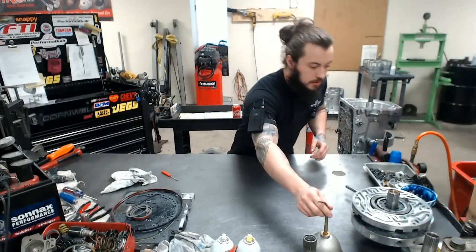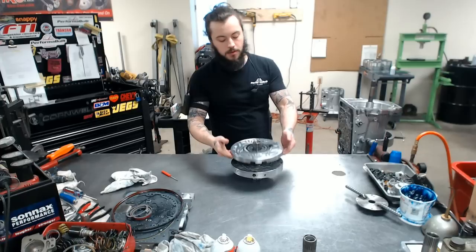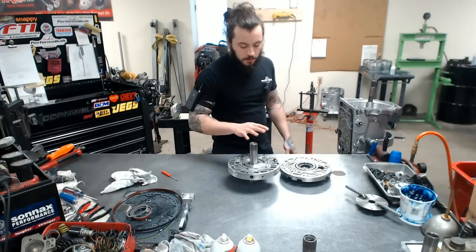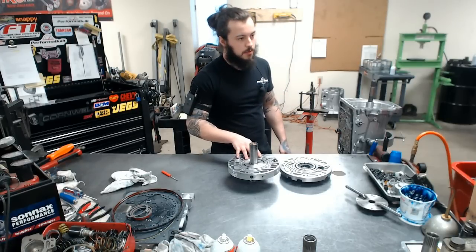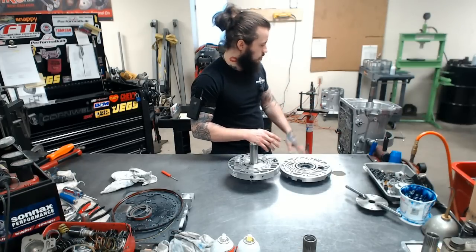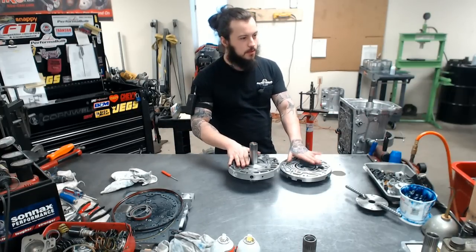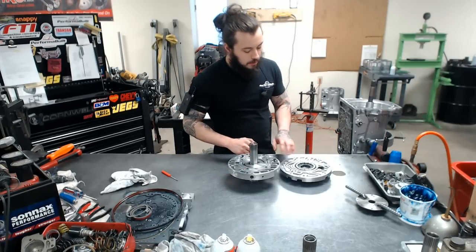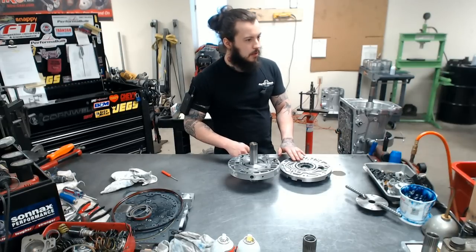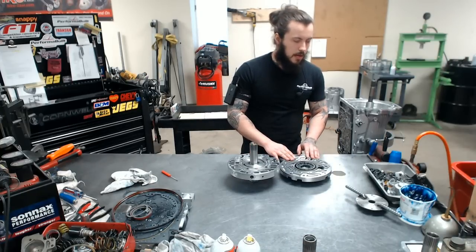And that brings us to the heart and soul, the pump. Okay, we have the pump here, and this is pretty much entirely the hydraulic system. This really, none of this does, even the valve body. This is the hydraulics. This feeds the oil, everything. And this is probably, in my opinion, the most important part of the transmission. Every little nuance must be taken into account with this.